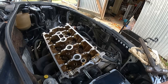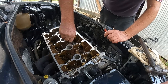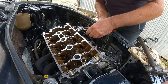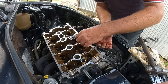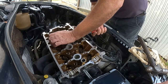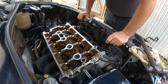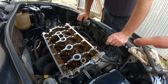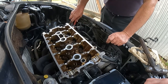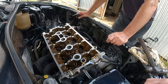This is an X size down screw extractor which goes deeper down — it's probably too small, but let's see how long that lasts. I have absolutely no faith in screw extractors, to be honest with you. Is there a theory — take the other ones out and then you've got a bit more play? Possibly, but you've got to remember your head's a dowel. There'll be dowels in these heads, so nothing's going to shift until everything can lift.